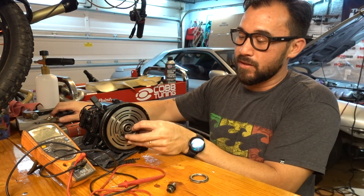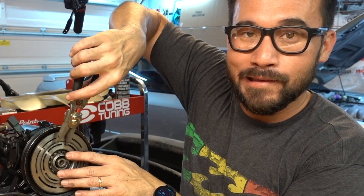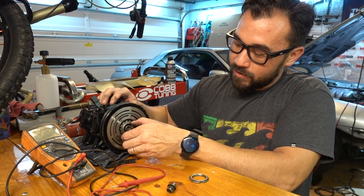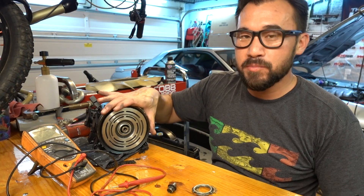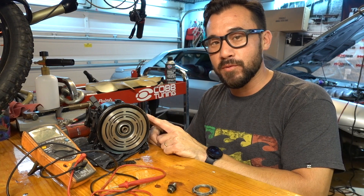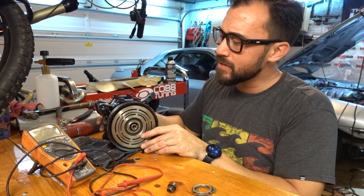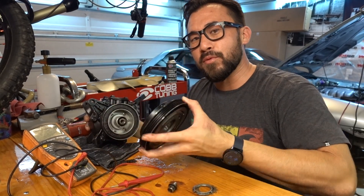You're just going to pull the snap ring off. This one has a lock ring in here. Sometimes these pulleys will come right off - on my Skyline it came right off, no problem. Sometimes they don't want to come off, like on some Jeeps I've had, and you need to use a puller to actually pull it off. This one will come right off because it's a rebuilt compressor - it's nice and clean, you can just pull it right apart.